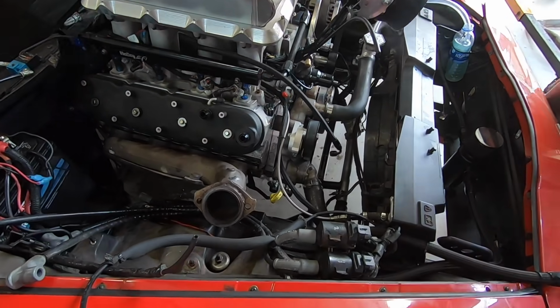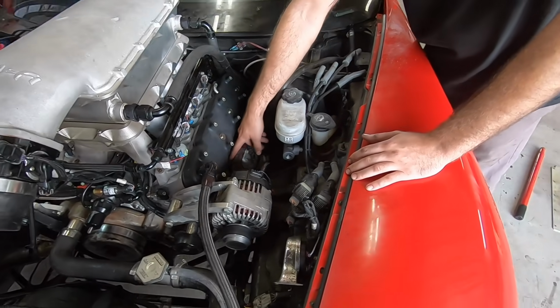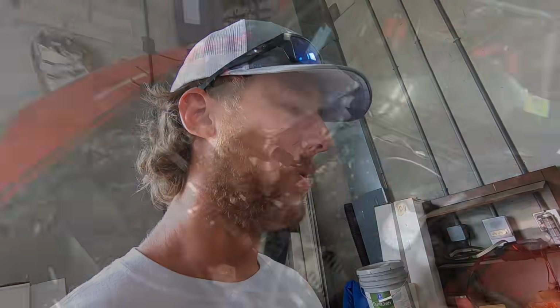But it's this side that's the huge issue, because we don't want to grind down. If you cut those off, you're taking a 6-bolt head and making it a standard head. We don't want to get the grinder out, heat up the side of one of the heads, cut into it, and maybe end up snagging the head gasket that's sticking out where those holes would go anyway.